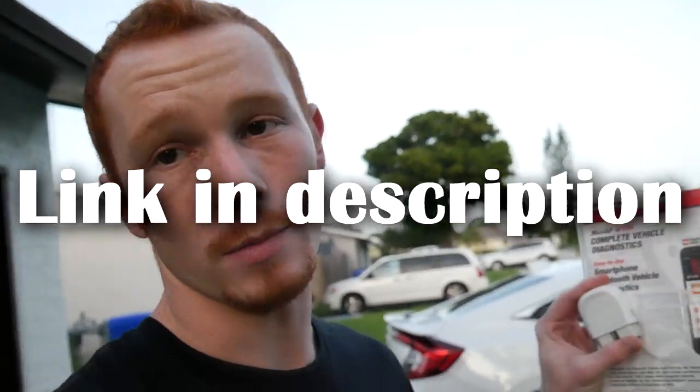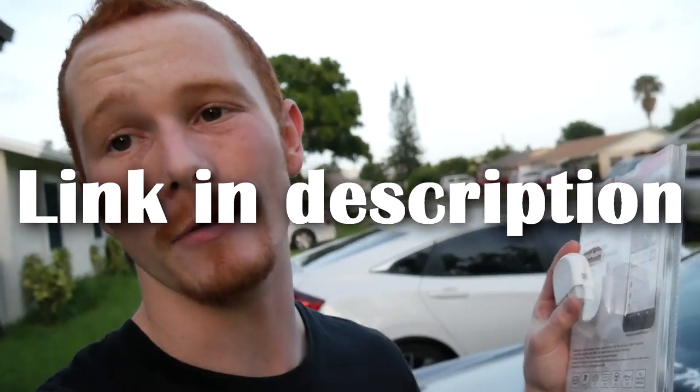It helps you read codes, live data, and a little bit more functions than the normal cheap Bluetooth adapters you get off Amazon. They're like seven dollars — chip in a little bit extra money for a lot more quality. They provide their own app which is free, really nice and easy to use. We're gonna go ahead and see if we can get any diagnostic done on the G. The check engine light was flashing, so I'm not sure if there are any codes stored. It's kind of weird because when you turn on the car there's no check engine light — only when you're driving and the RPMs are at like three or four K.